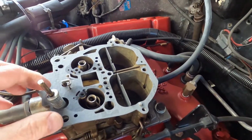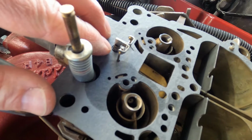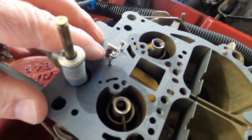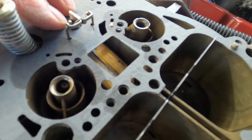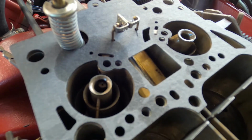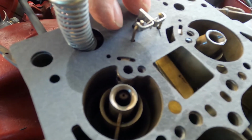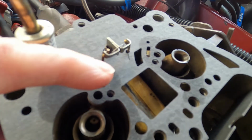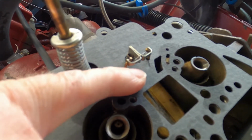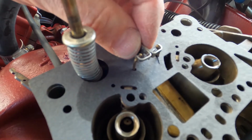Okay, our gasket's in there. Got to make sure it tucks around that primary jet system here. Make sure that gasket's tucked in there just right. It's got a little slit area that you kind of push up and get underneath, and it's a definite way to tuck that in there and then make sure it all sits flat. You can't really see it right now, the lines are hidden, but it's cut through, so gasket material can flap underneath that unit here that's holding the primary rods.